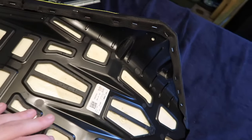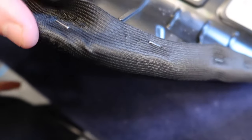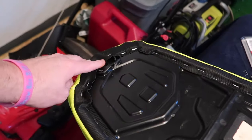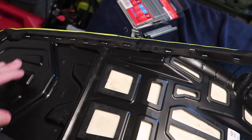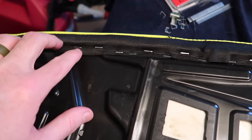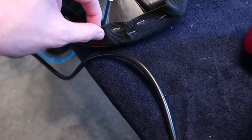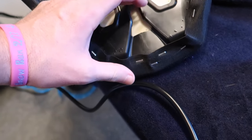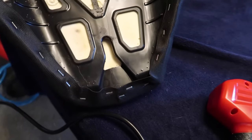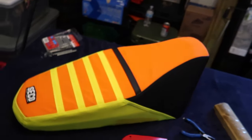In general, I got pretty much all the staples in. Some of the problem spots I'm running into are these edges — I just want to get a couple more staples in there, but for some reason my staples just will not cut into the plastic. The back is pretty good though. I was trying to originally staple a little higher up on the seat base and it wasn't going through, so I went back through, pulled the seat cover down a little bit, and was able to get a bunch of staples in. The front's okay — I still want to work on that. Some of these spots the plastic's a little thicker and my staple gun just will not go through it, so I'm going to keep working at it. But overall, I would say the seat looks pretty awesome.